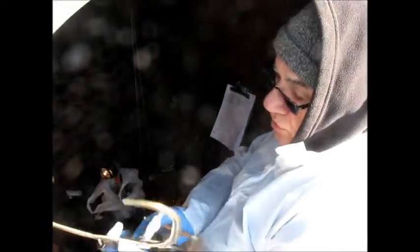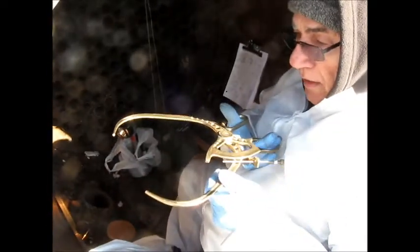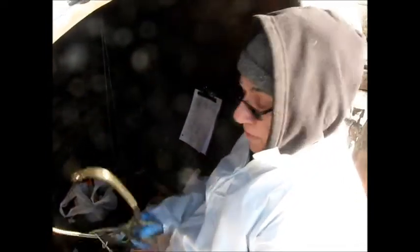Inside there I'm going to be taking off dimensions. This is a caliper that I made — one of the tools I made as an apprentice pattern maker. What it helps you do is take dimensions; it's adjustable. You can take dimensions inside of a casting, then open it up, take it out, and close it back up and measure what your dimension is. Which is very useful for what I'm going to be doing.